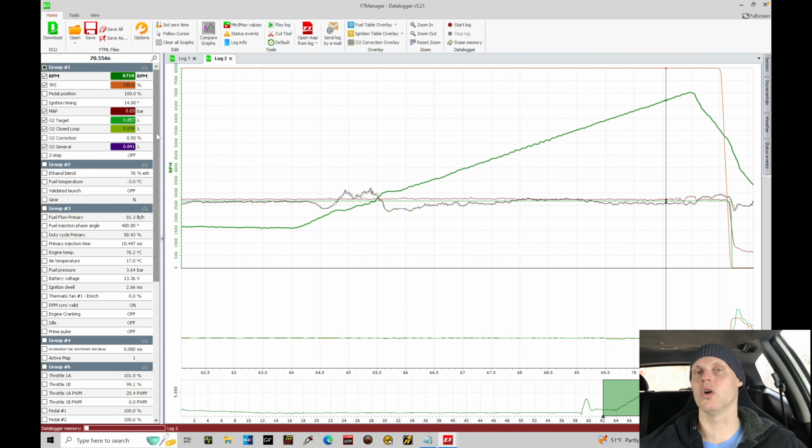So now let's take a look at our dyno graph, and let's compare it against our last run to get a feel for if what we're finding in the data is backing up what we see actually measured at the engine, and it should. So this would be the situation. You don't have a chassis dyno, you're doing your pulls, you're calibrating, you're adjusting the variable cam timing. Do you gain power or not? Obviously, looking at or using your butt dyno isn't a good indication. It's going to be taking a look at your O2 data and your fueling, what's going on with that, so we can get a pretty good feel for it.